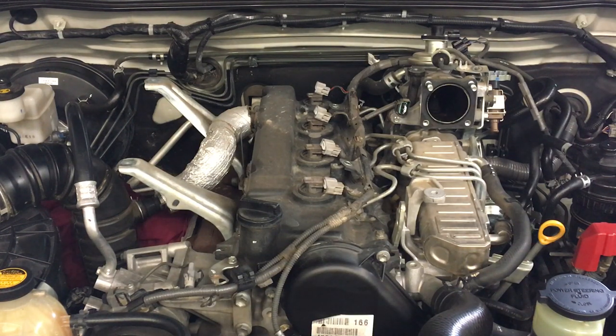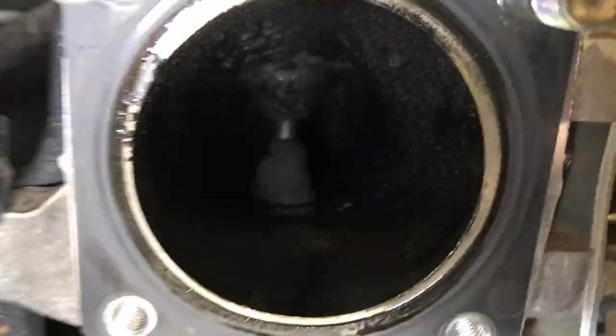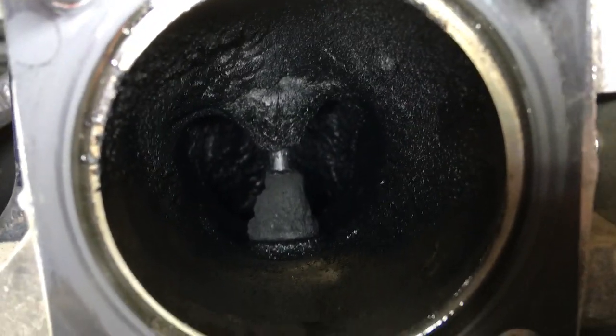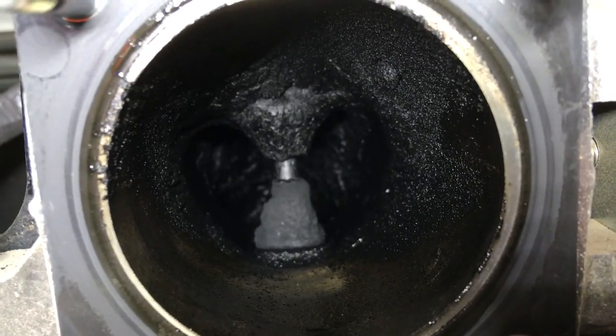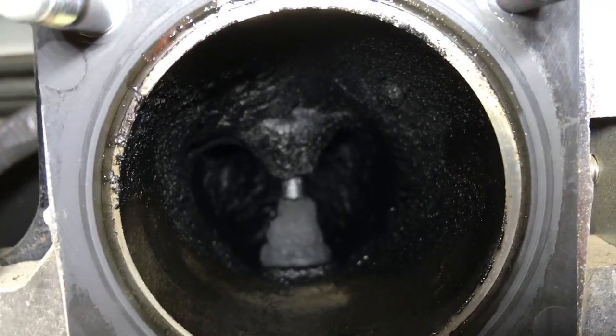I'll quickly show you the EGR. That looks like a 200,000km vehicle that's had plenty of EGR flow — it's all a bit mushed out as it got older with the oil trying to wash through it. If you clean that up and there was a plate to reduce the flow of the EGR, that'd stay nice and clean alloy.